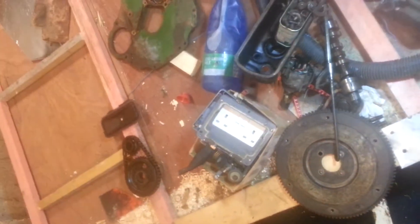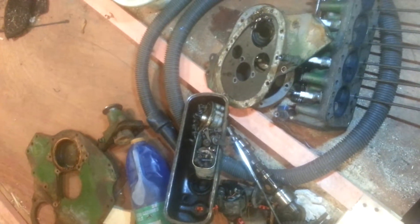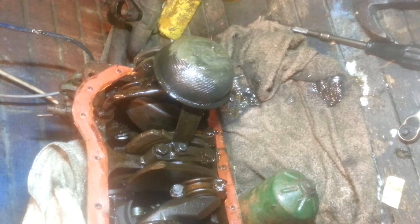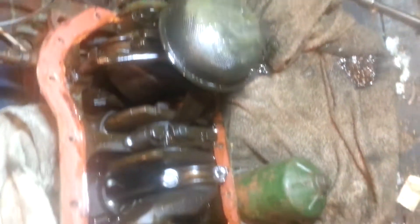There's the back plate, all nice and clean. So either this was possibly used for racing — I don't know — because they do have 900cc little old racing cars, don't they. Whether this engine was used for that is another matter, so it could be interesting on parts. I do have some old big ends that were in good order, but I won't put them in — I could use them as a pattern just to see how they fit. The old girl's had a bit of a caning.